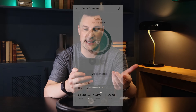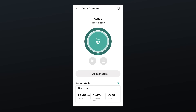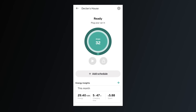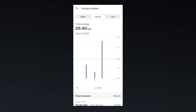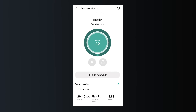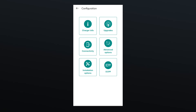It has an app where you can schedule charging, view your statistics and usage rates, remotely lock the charger — which turns the halo amber — and change the output levels from 32 amps all the way down to 6 amps. It has Bluetooth and Wi-Fi connectivity, and the charger also receives over-the-air firmware updates, so it will always be kept up to date with how it operates.